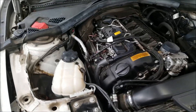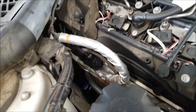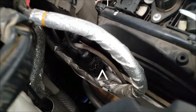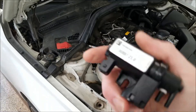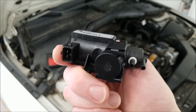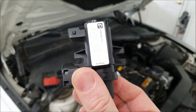This appears to be the vacuum-powered actuator for the wastegate, and this piece right down here. I'm going to be replacing that. This is what the new part looks like — it's got a couple pressure lines, one electrical connector, and looks like it's mounted by two bolts on that flange there.